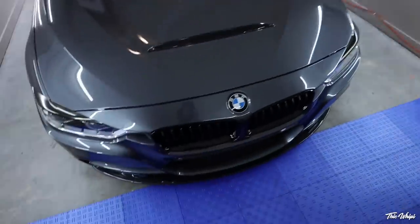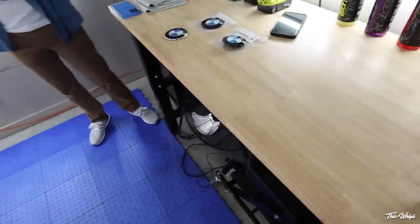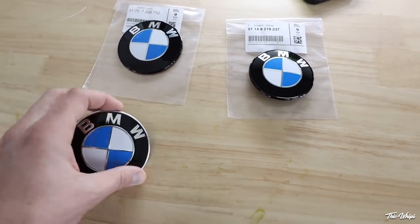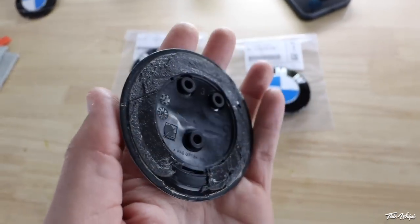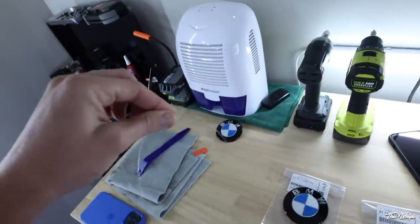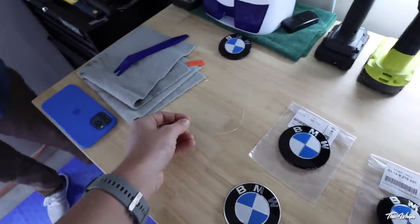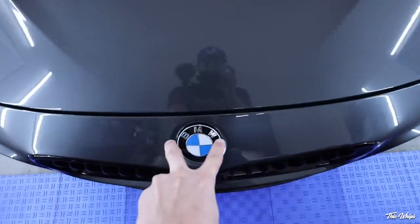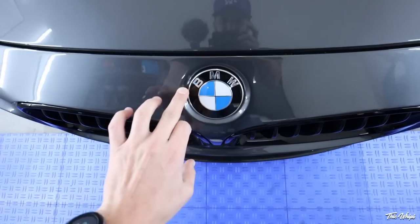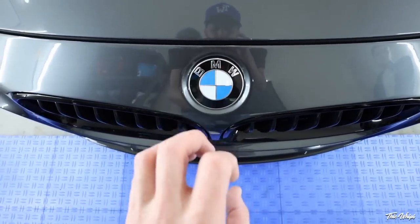We got his mineral gray F30 here in the garage and we are going to be putting on the badge. So I'm going to show you guys how to actually take off the old badges and put on the new ones. The front is actually just held on by adhesive — you can see the old adhesive here. The way I like to do it is use 30 pound fishing line. Use the fishing line for the front and the back to peel it off, but just make sure that once you put it behind the emblem you're pulling up on the string and down, and work your way through. You don't want that fishing line to hit the edge of the paint and mar it.